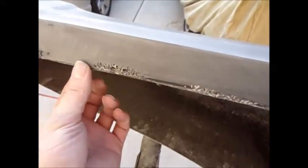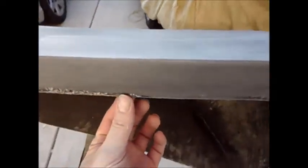I'm going to sand this whole bumper down and make sure I find all the imperfections first. Just got it sanded with 180 grit — only a couple of imperfections, little pinholes there. This edge has a few little pinholes and little craters that I've got to add some filler to; that's where the seam is. One little crater there from where the seam line was. A couple other little spots here, and on the inside — you don't really have to fix the inside, but I would because it's on the corner. I'm probably going to fill that in anyway, even though you won't see that side — it's reinforcement.